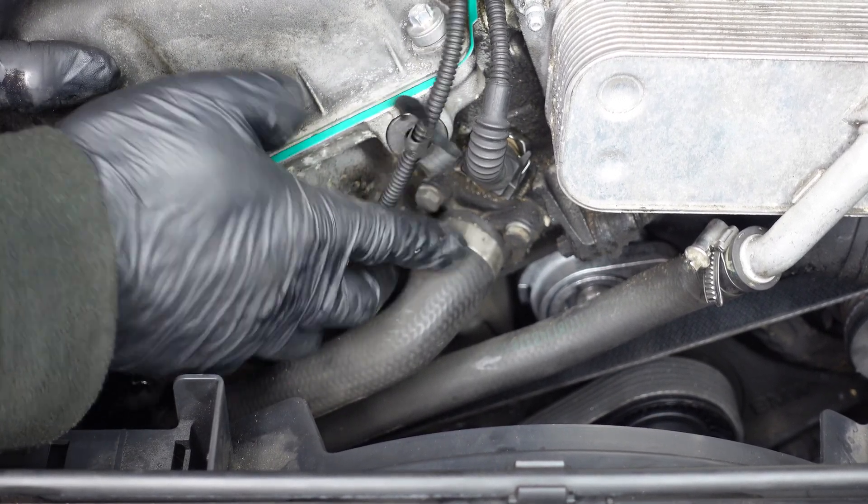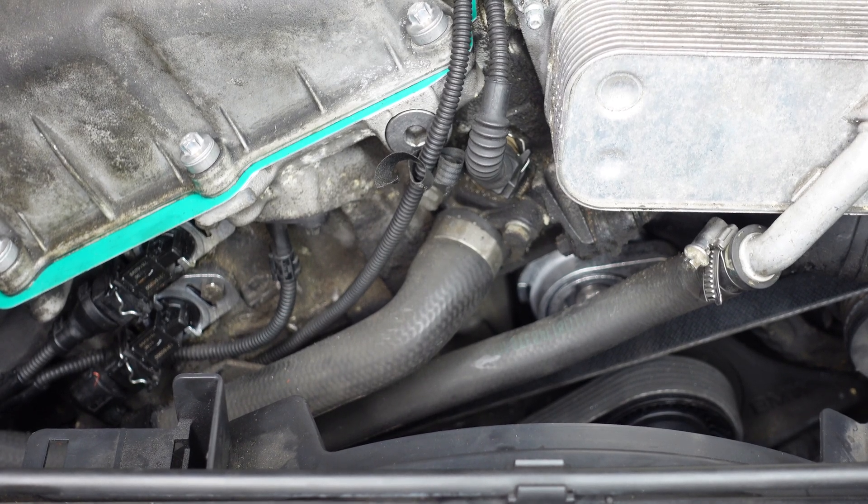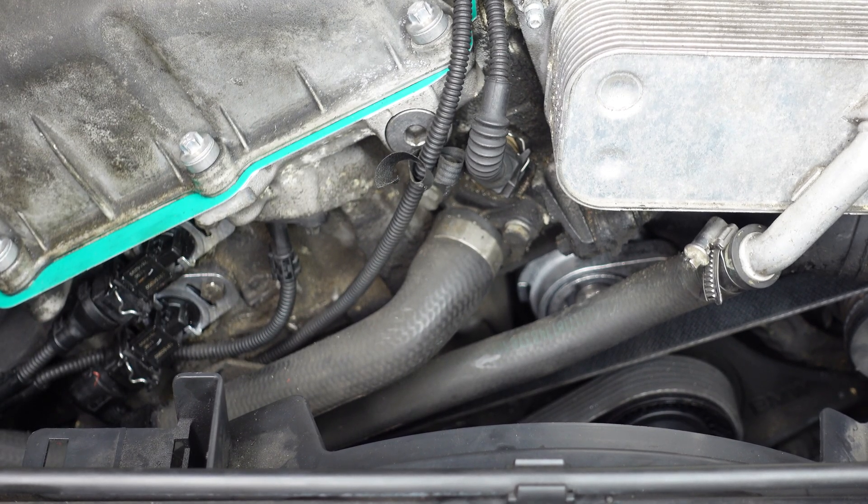You've also got this non-reusable clip that they put around it. We're not going to be using the old coolant flange or that clip. This is one of the reasons I actually chose to replace it — it's only cheap. It only cost me £10 for a new bit, and that wasn't a Chinese part; it was actually from MB Performance. For £10, I thought I'm not going to argue — I'll do it, because I was changing the coolant anyway. If I wasn't changing the coolant, I probably wouldn't have done it, because it means draining the coolant. I am curious to see the condition of this, because many people say they crumble and deteriorate. But this one hasn't been changed and hasn't had any coolant issues apart from the radiator hose.